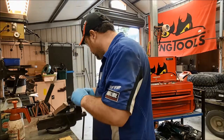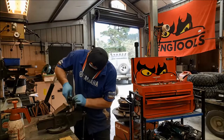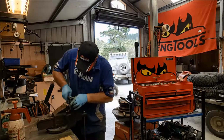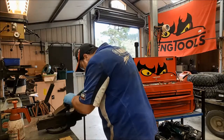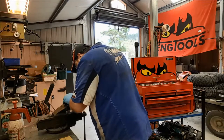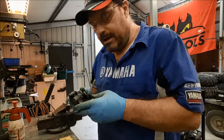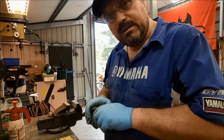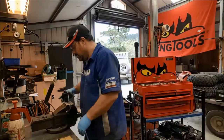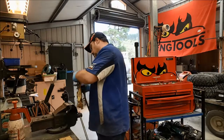It's going to be a real pain. I'm going to take those dust seals out. Shouldn't be that hard to go in. Well, when I'm doing normal steel piston calipers, I'll be expecting to be able to push those pistons in just with my thumbs. And there is no way, absolutely no way, that I can get those to go in just under thumb pressure. It's not going to deform. Let's just give it a go and see what happens. Never any guarantees.